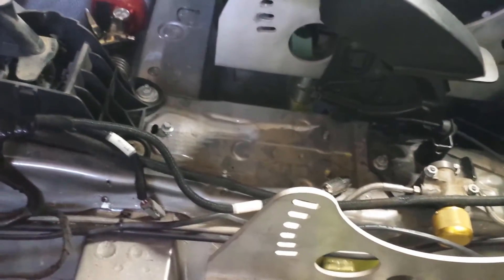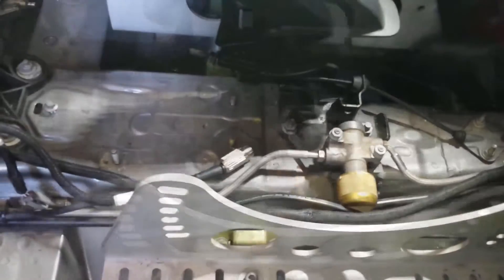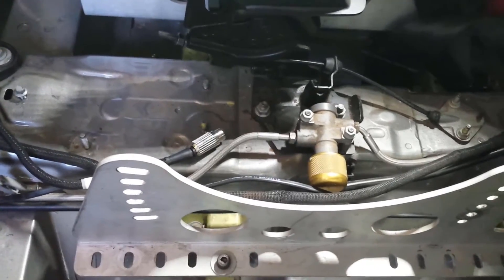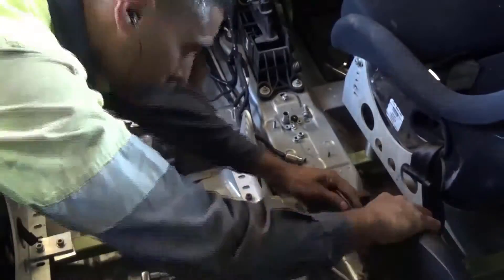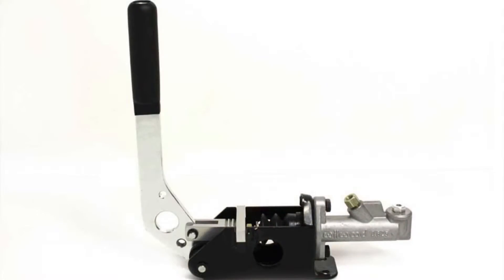At the moment this is all just laid out roughly because we have to put the final position of the handbrake in first. However, it has allowed us to remove the aluminium panel and give us more space on the transmission tunnel to mount the handbrake. Our next step is to take out the factory handbrake lever and the cable because we're going to a full hydraulic setup. So unbolt the handbrake lever, disconnect the handbrake cable, and remove them from under the car.